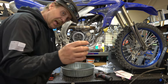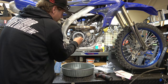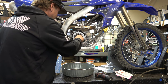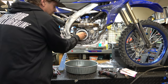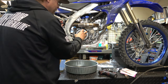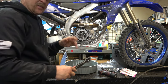Now we're going to put the locking nut on. It comes with its own lock washer — or tab lock, whatever you want to call it. Put that there and run this on. Once you buzz that down, you want to reach in to the inner hub and move it to make sure it moves freely, because you've got to make sure this basket gets all the way down and there are lots of little gears you need to line up. Now it's good — we can bend these tabs up. I just do one in case you have to take it back off, then you have another fresh one to use.